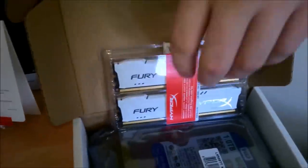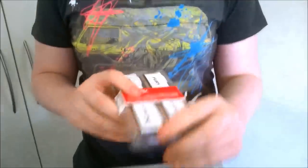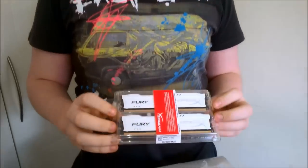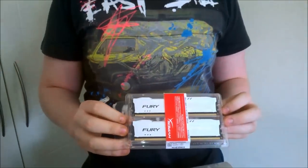It is a relatively long card but it's not too long where it's just obnoxious. Here we have an 8GB kit of HyperX Fury RAM running at 1866 speed. We will be swapping this out for some 2400 MHz Kingston HyperX from my system mainly because I want the white ones. The faster RAM will also help with gaming. My motherboard can't handle 2400 anyway so it doesn't really matter to me.